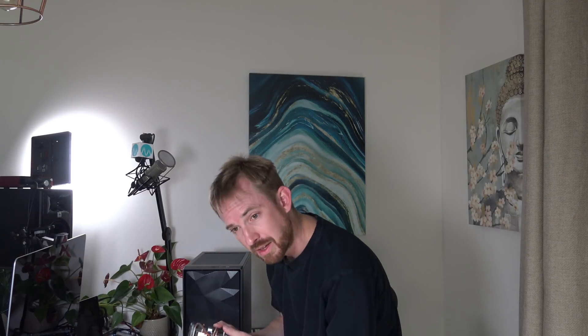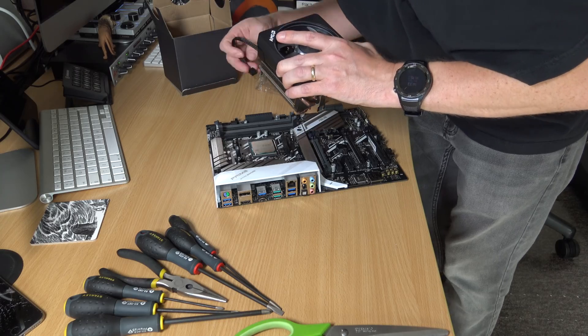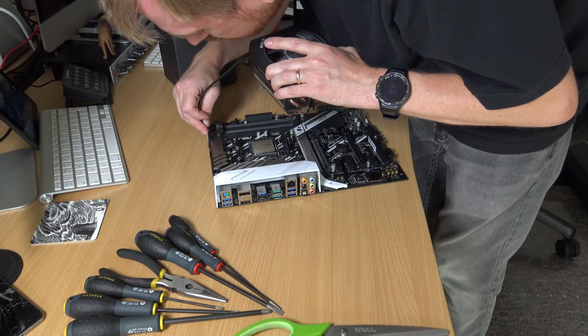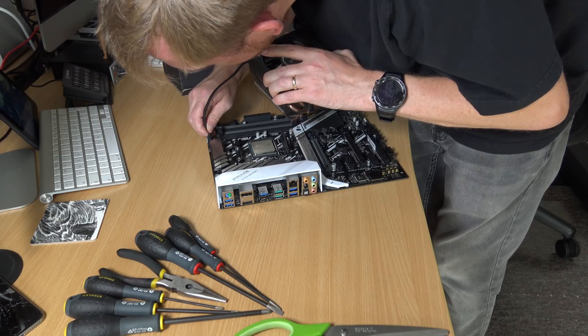Next, I need to get the fan out. Thermal paste — really good thing that AMD did there with the stock cooler. The stock cooler that AMD sends with the 2700X actually has thermal paste pre-applied on the bottom. So I don't need to worry about applying any thermal paste — no little peas or rice grains on top of the CPU. It's all done for me, which is great. CPU fan going on now — those are the CPU fan pins right there.